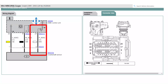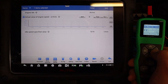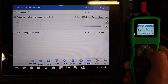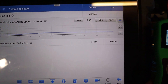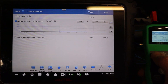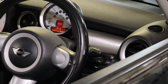Now we're going to use it to test the crankshaft sensor signal on this car. I've used the wiring diagram to find the crankshaft sensor signal wire in the ECU — that's the easiest way to access it. I'm using the sensor test kit with some 4mm banana probes and back probes to get into that signal. With the live data showing on the scan tool, we increase the frequency of that signal and we can see the engine speed starting to increase — 13 rpm, 14 rpm. If you increase it too far with just the ignition on it will register a fault and cut the signal off. We got it up to 795 rpm at 794 hertz — a bit of a correlation there. The ECU has cut off, having detected that the engine isn't actually running while receiving a crank signal. This is a nice way to test the RPM signal.